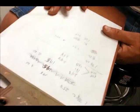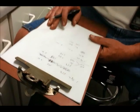In this case, the results were just night and day. We saw an average temperature in the mid-200s with the coated headers, jumping to 870 degrees with the black headers. Wow, that's huge. And think of all that heat pumping into your engine bay or passenger compartment in your running car. That makes a real difference to how your street car performs on a daily basis.